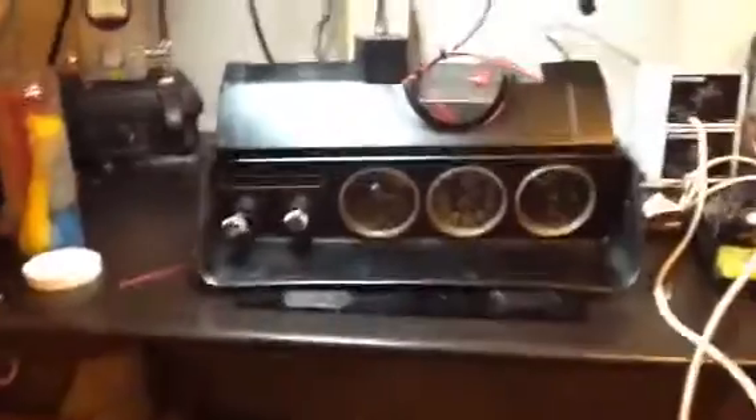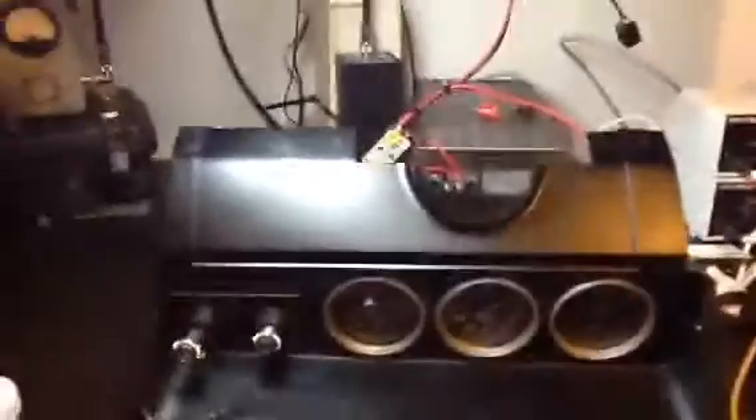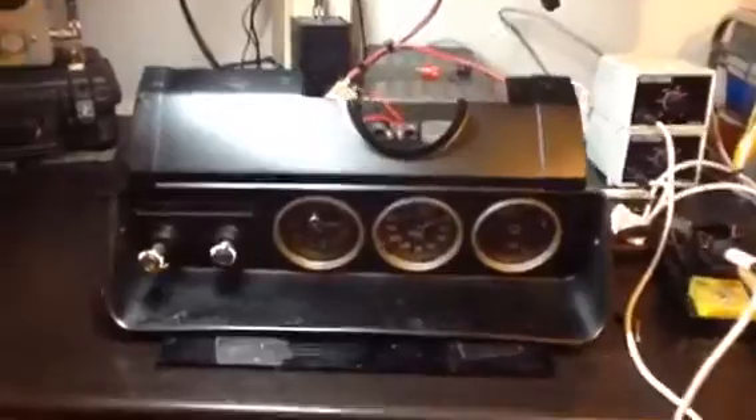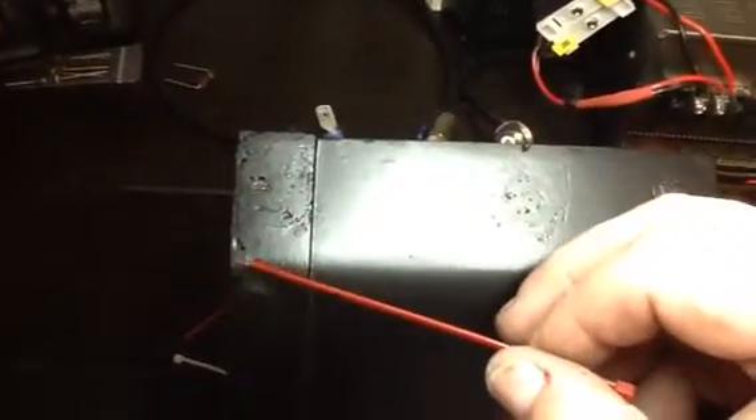Here is the instrument cluster. This is the one I began working on and showing fellow YouTubers the other day when I introduced plastic welding. I focused on mainly filling in the holes up here, along there, and along there. And this bit did not exist — this whole section from here down to there was totally missing. So what I've done is build that up, and it's that tough.